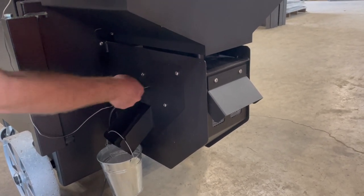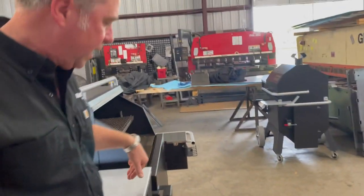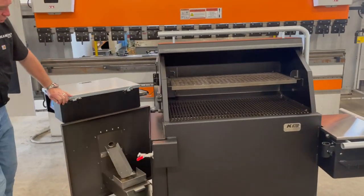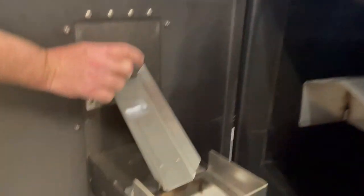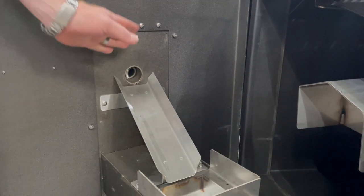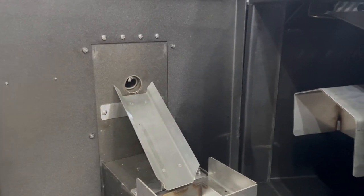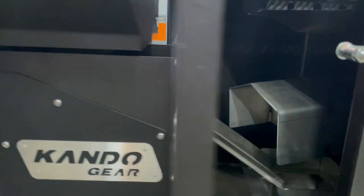But there's one thing that you need to remember: you still leave it on as if it's still cooking. And what that's going to do is continue to run the auger screw. There's about a four-inch piece right here — we want to auger out those pellets that are remaining in there. Once you can take a look at it and see that all of the pellets are out, which just takes a minute, those remaining pellets would be in your fire cup.